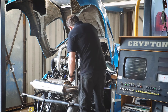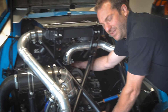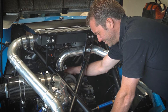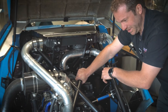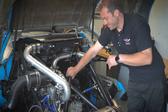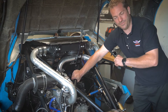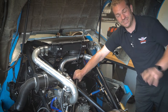At the front of the engine, we've removed one of the pulleys. We had two pulleys — one originally driving the oil pump and another belt driving the supercharger, and then another one driving the alternator and water pump. But we've incorporated everything into one belt now. It's got one belt driving the alternator and the supercharger, that's it. There's a separate drive for the oil pump, and the water pump's drive is taken off the cam belt this time, because it's a slightly different engine layout.